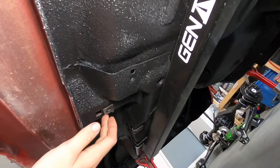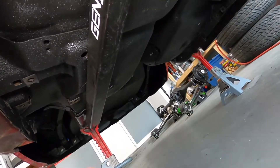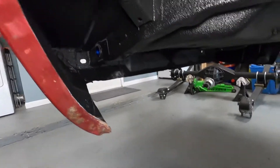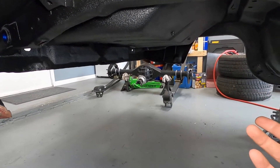The subframe connectors are on, fully bolted up and tight. The subframe is done and complete. Now we just put our little clip nuts back in for our rear end shackle - this is the forward mount for the rear end leaf springs. We'll go ahead and get these bushings cleaned up, then get the rear end over here, get it in line. We'll probably install the aft portion first then the forward portion, grind them down, put some sealant on, and put the rear end in.